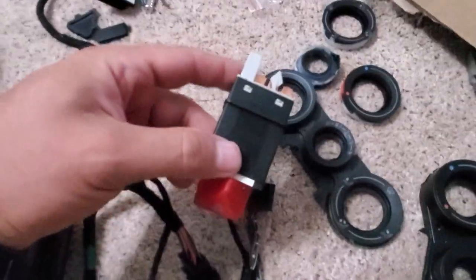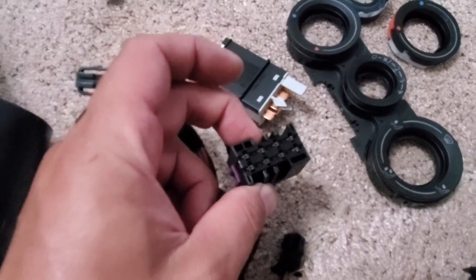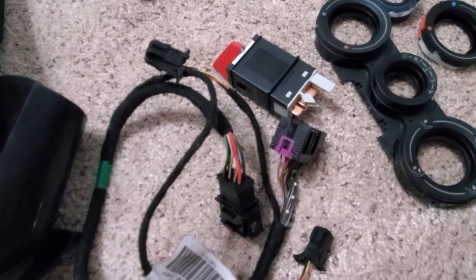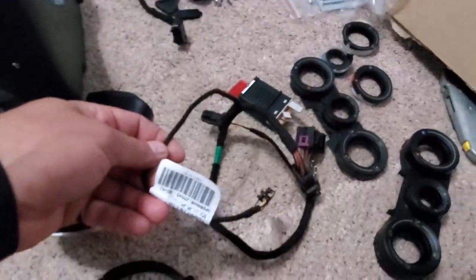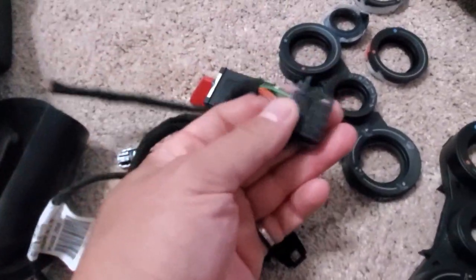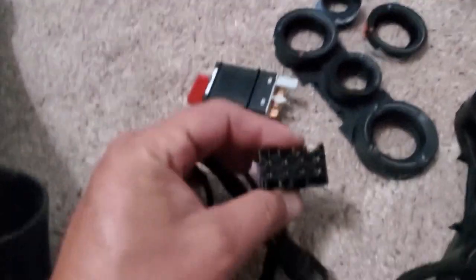Here is the hazard switch. This part plugs into the hazard lights, and your hazard light switch in your car is like this — it would reach if you didn't have to pull the radio out. So you can get this harness adapter. This is for the airbag light — mine's not going to use it for the passenger airbag light because it's a 2000. The other end that plugs into the car is this end, which came from the car. So what I have to do is put the male splicers onto this so I can plug into here and then that end to the plug in the car, just to convert it so it's longer.